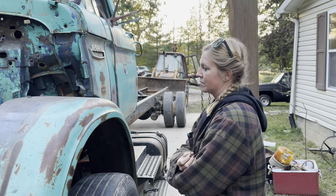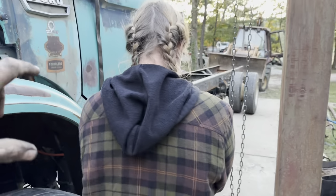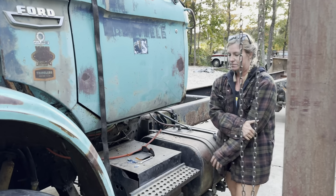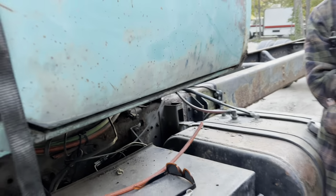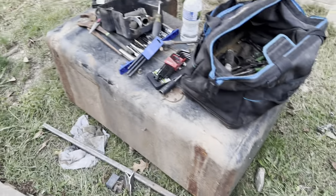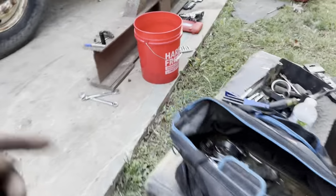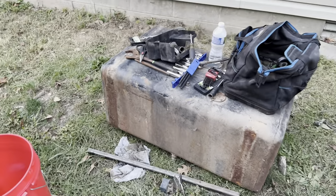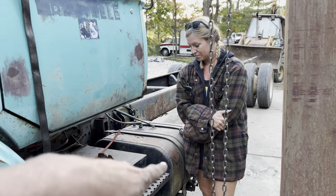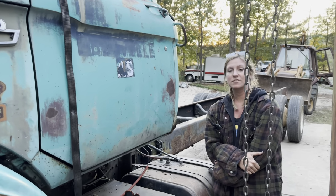And we had an idea on the batteries. So right now we got a giant gap. I was wanting to leave these in there. I was wanting to leave all this alone, but the giant gap kind of sucks. Even at 3 inches, it's still going to be a pretty decent size gap. So I think what we're going to do is take this original fuel tank here. This one goes on the driver's side, carve it out on the back side and the bottom, leave the top and the front and the sides, and sleeve it over the batteries to hide it, get rid of this fuel tank completely. And then on the other side, we're gonna use the 1965 fuel tank, because we'll have to put the air somewhere too.